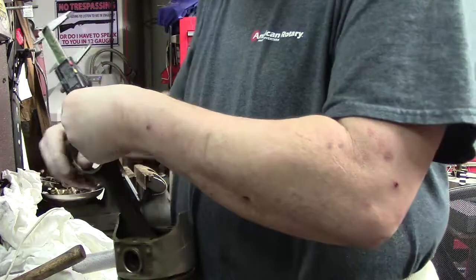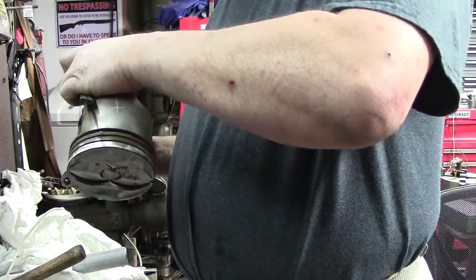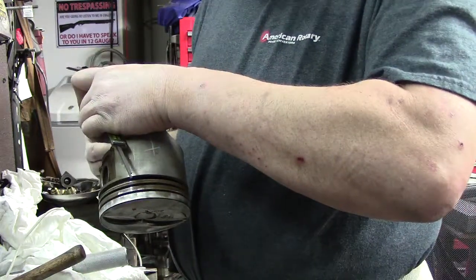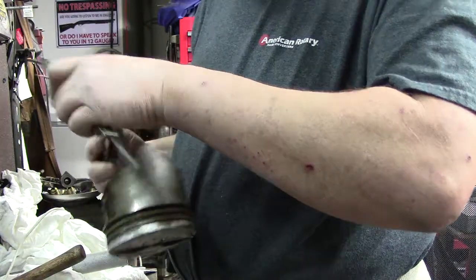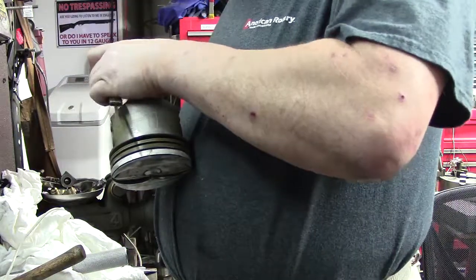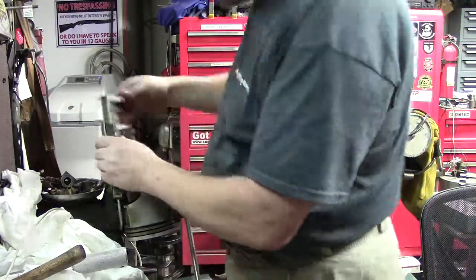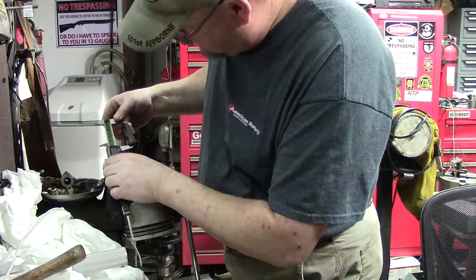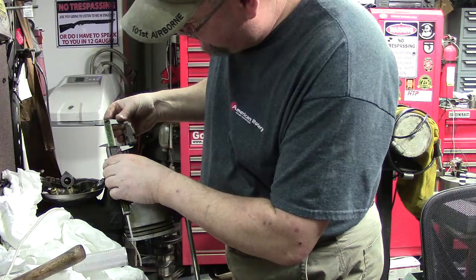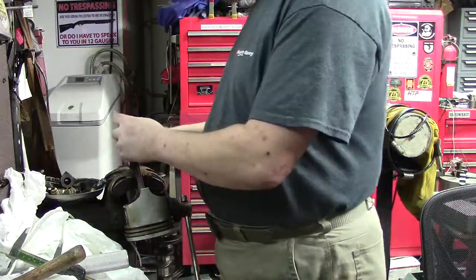Alright, we're going to measure this one first before we torque it. And we're going to see how much this changes. 2.435. And let me put this in here. I got the shakes. Too much coffee. No, I'm just kidding. Okay. And this one, yeah, this is the one that's stretched. So this one's 2.422. So this is the other side, okay, because I already loosened it.